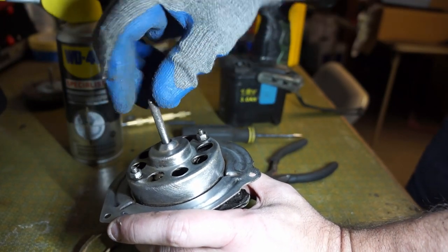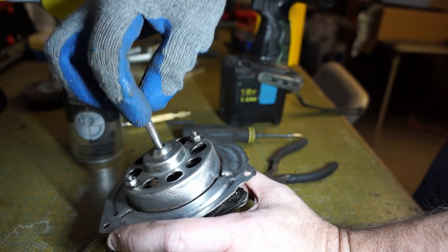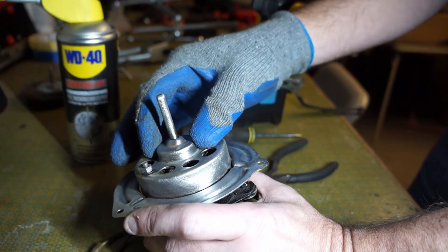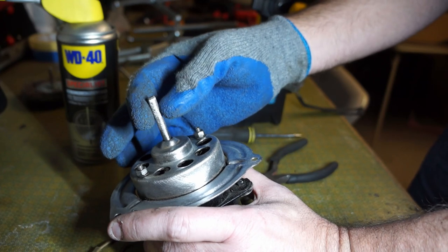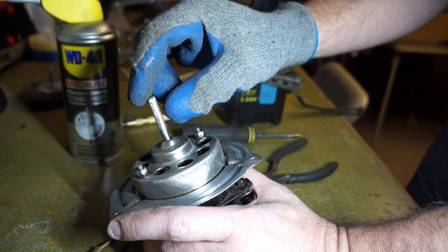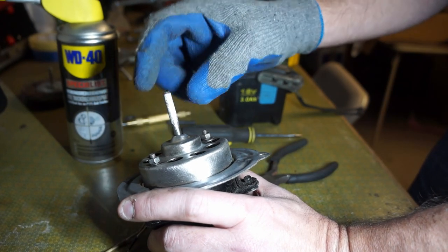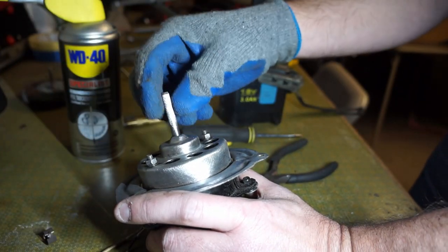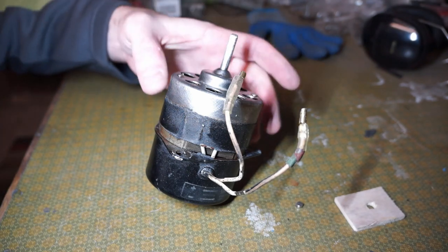After a lot of swearing, prying, and pulling, I finally got the plastic fan off the center shaft. What would help is if you clean off with a Dremel or something some of the old rust that might be built up on the end of the shaft — then it'll pull off a little bit easier. I thought there was a lip on the end preventing the tines on the plastic from pulling off, but there's not. It's just a pressure fitting, so once you get that metal ring off it should pull off, but there was some old rust that made it difficult.